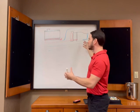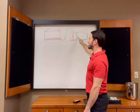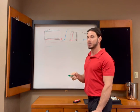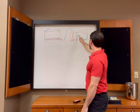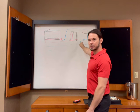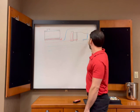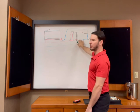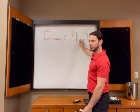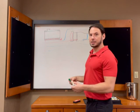This is my pool of available fluid that I'm going to use to lubricate my clutches. I'm going to try to use it to pressurize my high clutch. That's a little joke for later. And everything I need to do in this transmission, lubricate the planetaries, run the transfer clutch, all that stuff, all through the valve body, is going to be drawn from this fluid that's just resting here. And that's exactly what the TCU does.